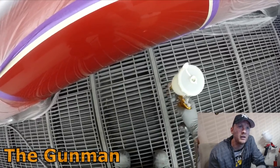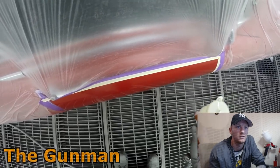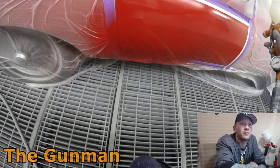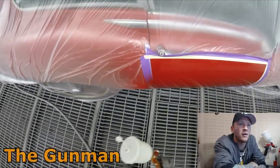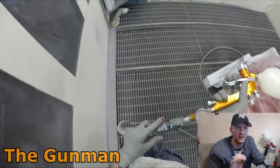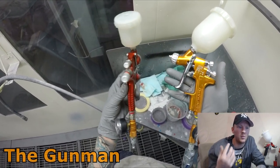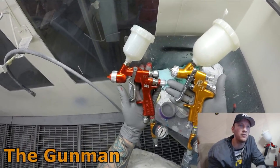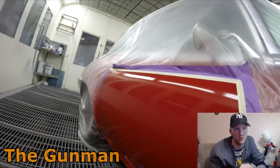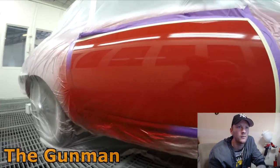Then we'll just go over the top of the edge of that with some straight AK 350 or blending thinner, fade-out thinner. You are best off using a purpose-designed fade-out thinner though obviously. This gun here is now actually in America — a guy from the US bought it off me. You do have to be careful about overdoing it to that edge as well. There is a little bit of thinners that has gone up to that masking edge of mine.